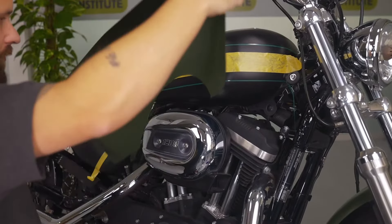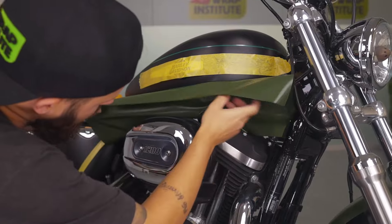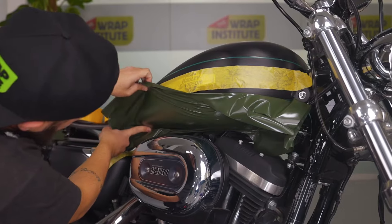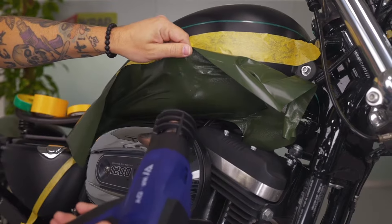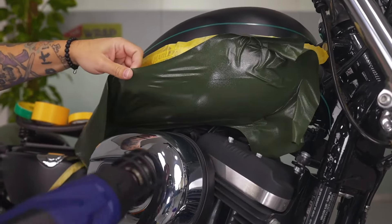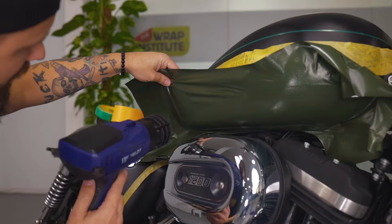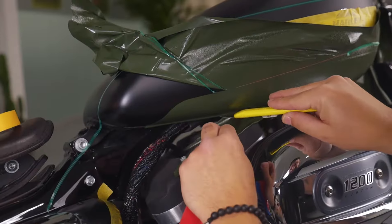With the section roughly pre-cut to shape, it slides in on the underside. It's very important to even out the tension so there's not too much on the edges. Pull along the bottom nice and firm, which stretches the material slightly, so for the top sections where the material bunches up, it's heated and literally shrinks into place. This is called the Wrap Institute Wrap Matrix logic, which works really well for compound curves. As the material shrinks to the edge, simply squeegee the film onto the surface then release the knifeless tape from one side to the other.